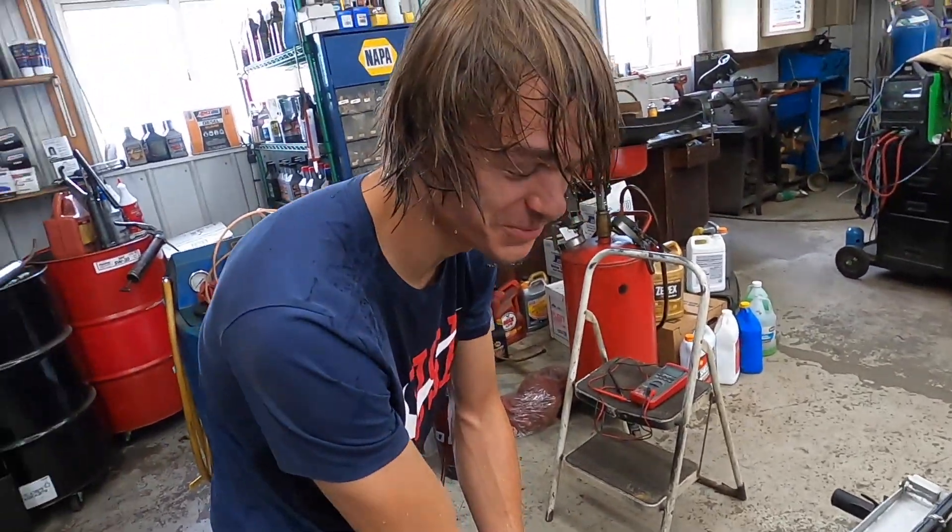So we were kind of talking about that as a T4, and we're looking at possibly doing a T6 very, very shortly. When I come back up, hopefully we'll have that back on. Should be able to alleviate some of the back pressure there. If we're making 27 pounds of boost, we're probably seeing maybe about 40 pounds of back pressure right there.